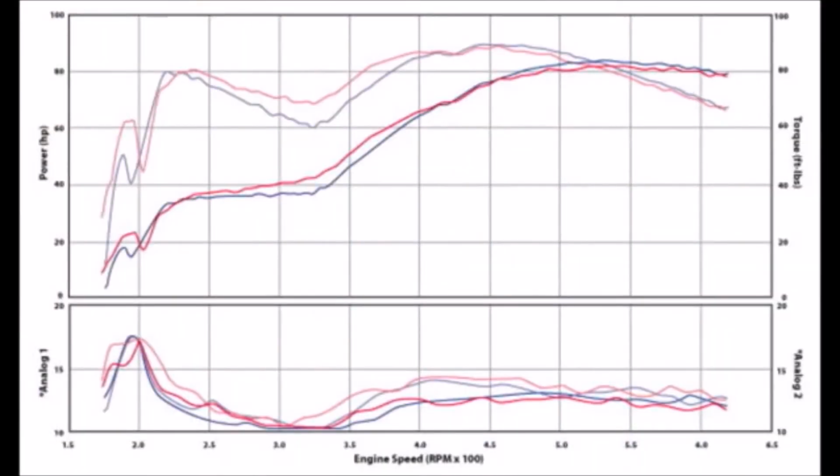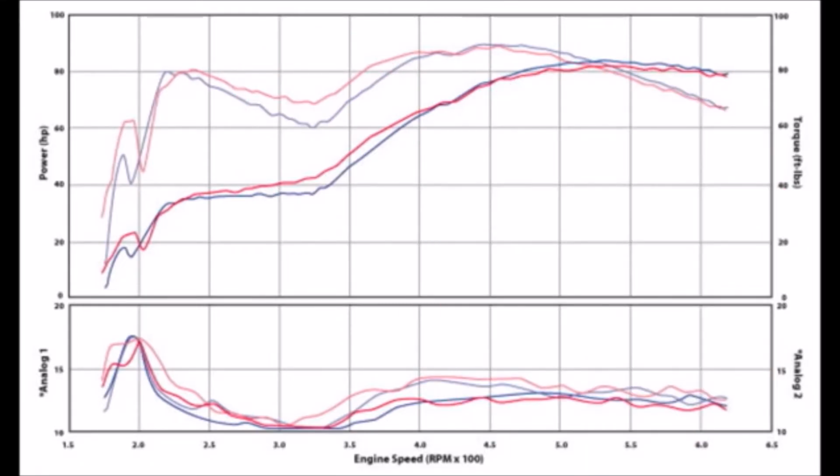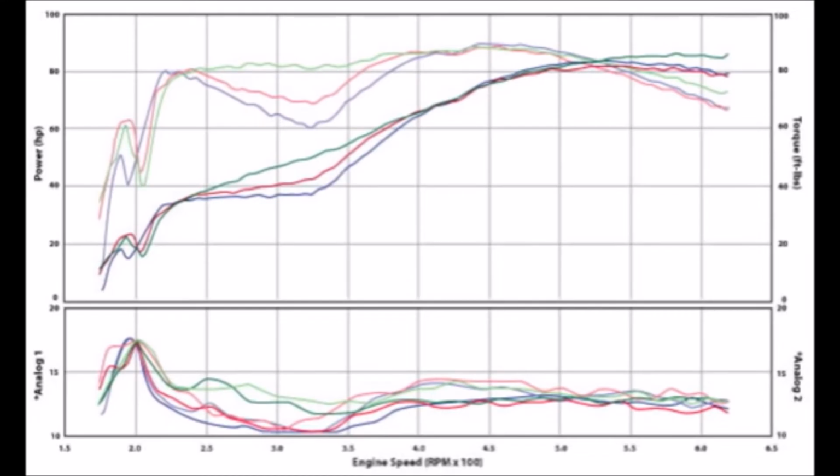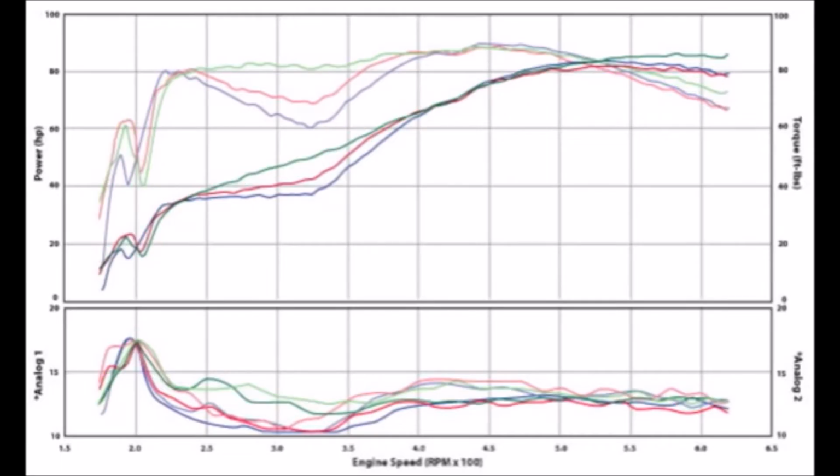It appears there is some improvement in the mid-range, and the bolt in the pipe didn't reduce the overall performance significantly, so this may be a useful tool to combat drag pipe sag, even if it does chirp a bit. But the critical mid-range still isn't as good when compared to a mufflered exhaust system. But if you're willing to settle for less performance to achieve a look and sound, this is an option.